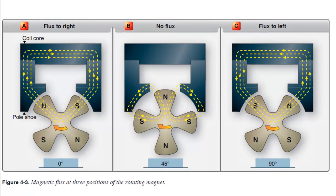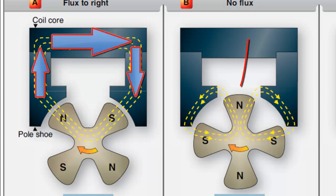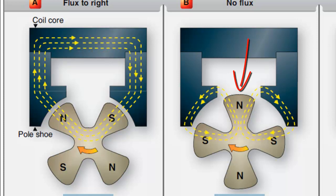This shows how the magneto works, and by the way this is how it gets its name — magneto comes from magnet. This four-pole magnet spins inside the magneto exactly in proportion to the engine speed. It's all geared directly to the engine. When the poles are lined up with the pole shoes, the magnetic flux from the magnet is transferred into the coil core. When the poles disalign with the pole shoes, the coil core doesn't have any flux flowing through it. It's this change in flux that we take advantage of — not so much the strength of the flux, but the change in strength of the flux.